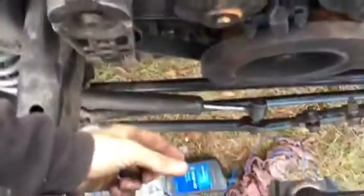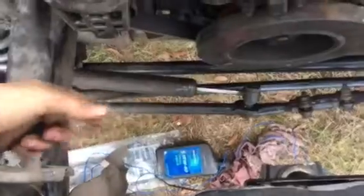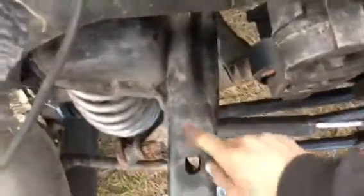The hard part though is going to be here, because the bottom one sticks out probably about this far. So I'm going to have to come out, bend 90 again to come here, and then bend another 90. So I don't know. I'm probably gonna have to run up the frame rail here just so I have enough space, which means I'm gonna have to put my coilover hoops on the outside of the frame and angle in.